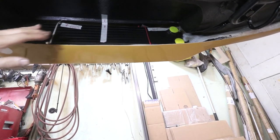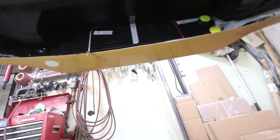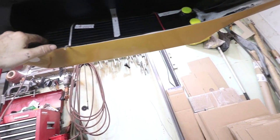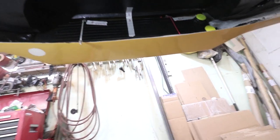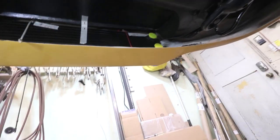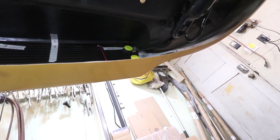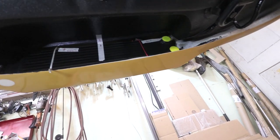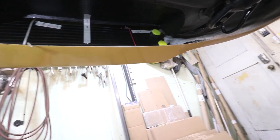Imagine if there was no cutout. This wall would continue straight down all the way to this surface. So the only airflow you would get would be in the bottom like two rows or maybe three rows because this would be completely cut off. So the only way to make these front coolers work is to create this cavity behind. And I'll show you from the inside in a second. But this cavity that I created is big enough because it doesn't obscure any of the rows and it allows the air to make a generous turn going down.